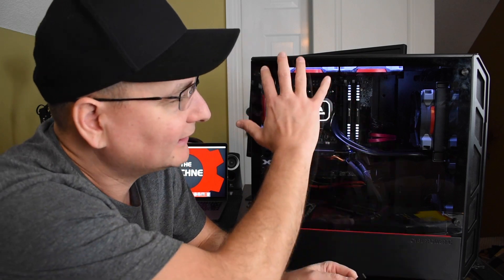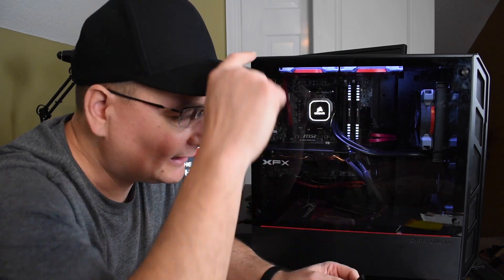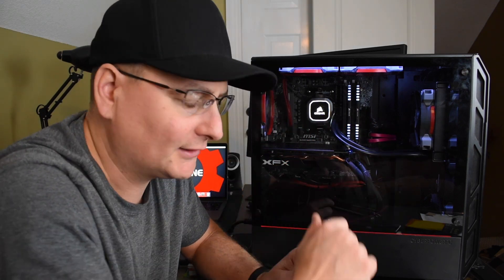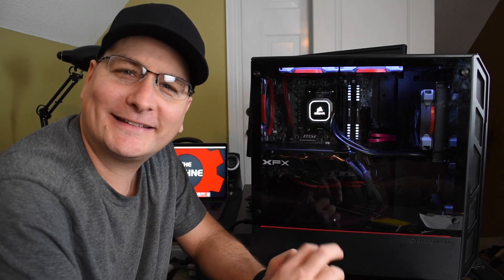If you're lacking fan headers or need to add more fans to your case, I highly recommend getting a hub. This one is only about 11 to 12 bucks. It's a super easy install — runs straight off SATA, you don't have to plug it into your motherboard at all, just plug it into your power supply. Fans don't draw much power so you're safe there. You'll still be able to control whatever fans you put on your motherboard headers, and this hub just gives you a little extra air push or pull. Thanks so much for watching — hit that thumbs up and subscribe to catch the next one!